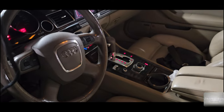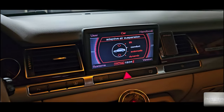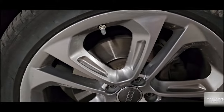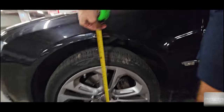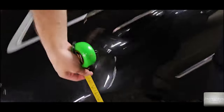Let's turn the car off and back on to see if the calibration worked. We're in comfort mode — let's go out and close the door to see how the car sits now. Checking the left wheel: from the middle straight to the fender, we have 420mm.